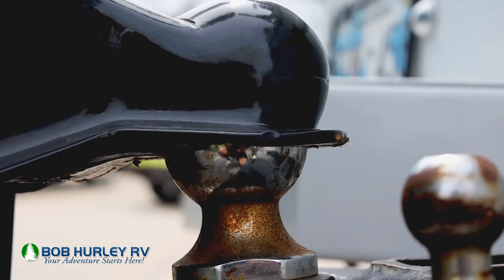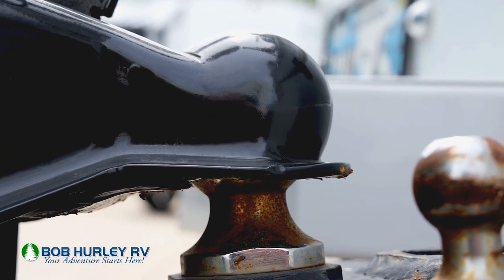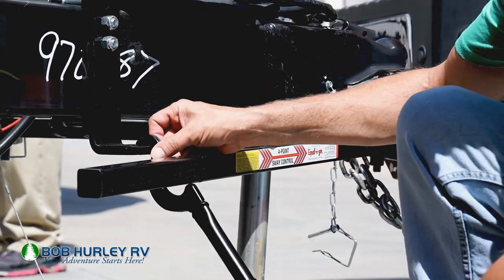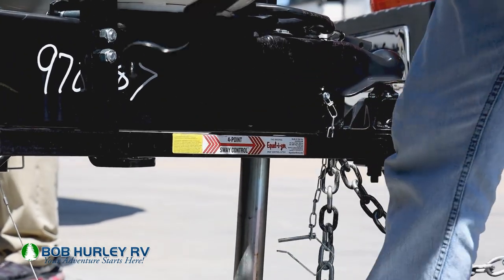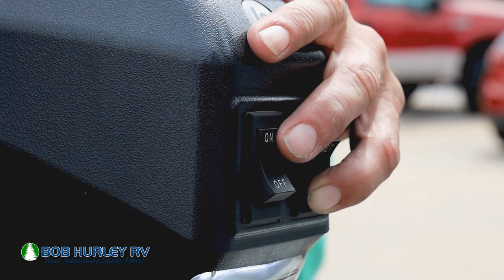This looks a little bit more daunting than Papa's flatbed trailer. There's no hand crank — there's bars everywhere. Can you show me how to do it? Yes, Derek, it's actually a little easier than what it looks like. So when we get ready, we got our weight distribution hitch pinned into our truck. We're going to back our truck up under the trailer, lower the trailer down on the ball and couple it at that time. Then jack them both up past level. Once we get them both up past level, we put our bars on and snap them on the L brackets mounted on the frame of our trailer. Once we get that, we lower the trailer back down with the electric jack — it's just all pushing a button, so it's real nice. Once you get it lowered down, we're ready to travel down the road.